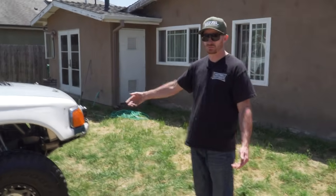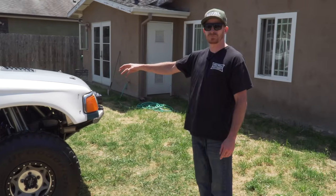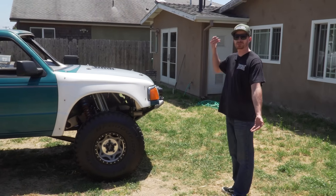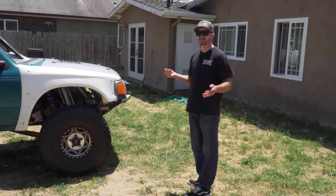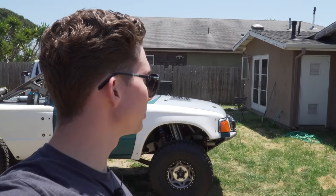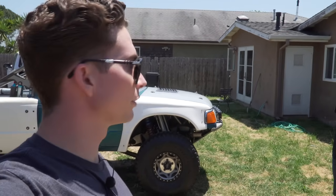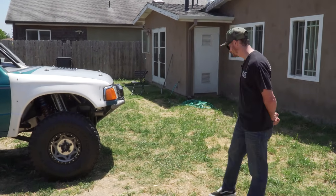The front of this thing is strapped at 21 inches of travel. I never really measured it before because honestly at this extent of a truck, wheel travel is kind of a measuring contest. The only thing I care about is up travel from ride height. Droop travel — where your overall travel number comes from — I could care less about, because I know all these trucks are going to be over 18 inches. When you're between 20 to 24 inches of wheel travel, it's all the same at the end of the day. You want enough wheel travel to keep the tire on the ground in whip sections, but at very high speed there's not enough rebound force for the tire to use all that travel. So 21 is healthy — that's a lot.